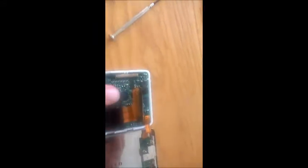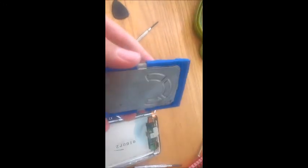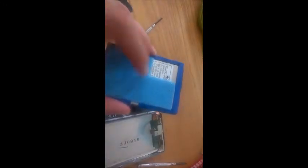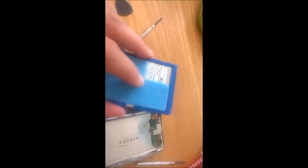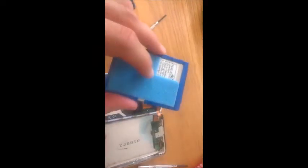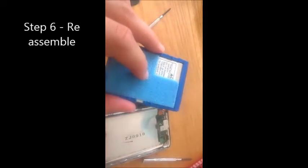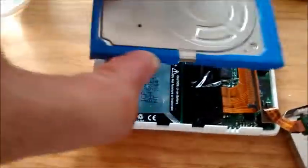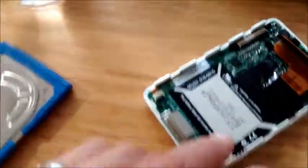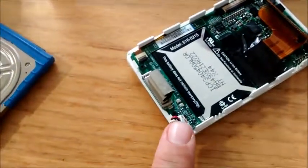You've got the battery there, the connection cable that goes across to your headphones and switch, the circuit board, and the screen behind it. This is your hard drive — if you want to replace it for a bigger one you can; links for replacement standard Apple ones and larger ones are provided. To put it back, simply plug the hard drive back in, connect the connector back onto the circuit board, close it up and push it back.